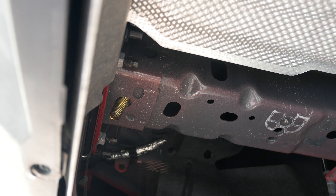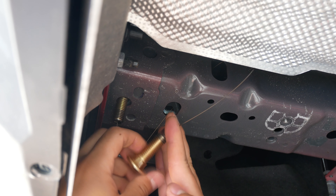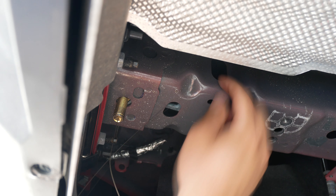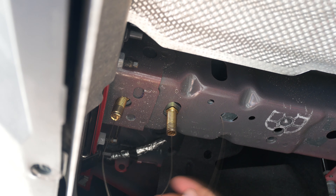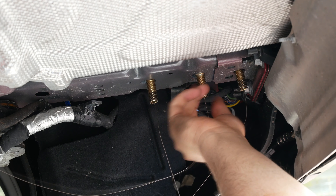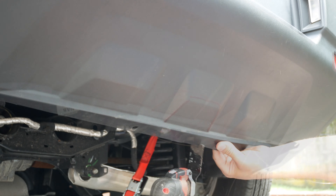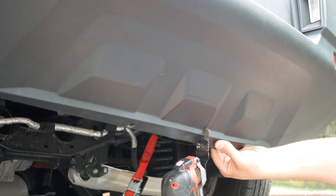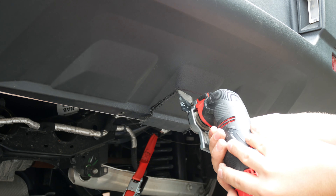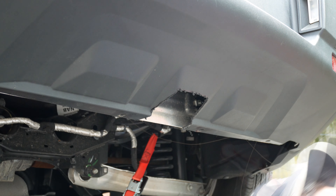Then you'll just want to repeat that same exact process three times on each side. So we're going to be marking off and cutting out the piece of our bumper that will allow the hitch receiver to fit in place. The Bronco makes it easy as you can see — I'm following the design there, but it seems that for a class three hitch, we'll need to go just a bit higher. Using an oscillating multi-tool, we're just going to knock this out. Then we can use a knife to help clean up all the burrs.